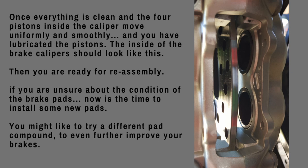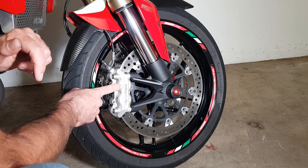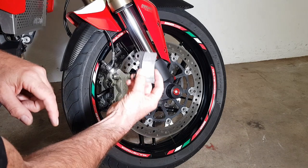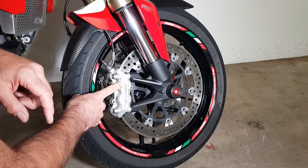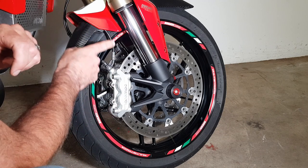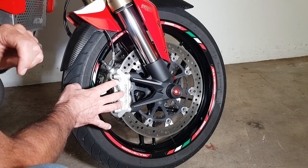On this image you can see the pistons are fully retracted, pushed back into their ports, and there is no excess lubricant. You need to make sure the inside of your calipers look like this — spotless. Use a lint-free rag with brake cleaner spray to clean the inside and remove any excess. Be really careful: there's not a lot of free travel with those pistons inside. Once you take the caliper off the disc and remove the pads, you must not press the brake lever — those pistons will pop out very easily.